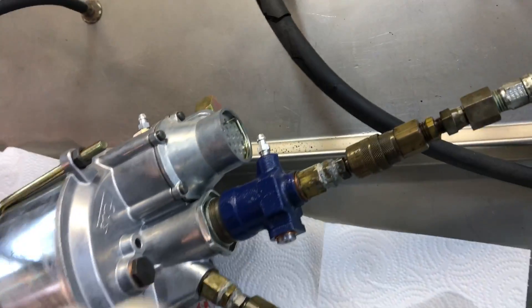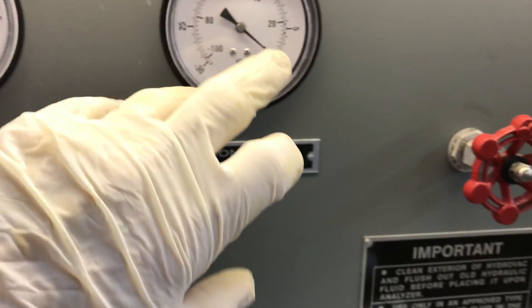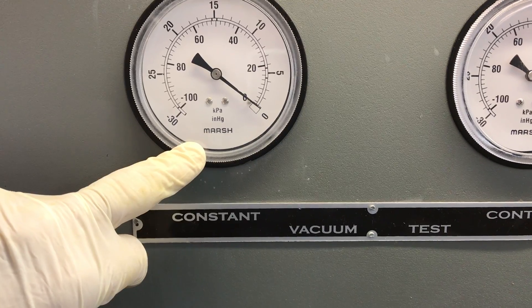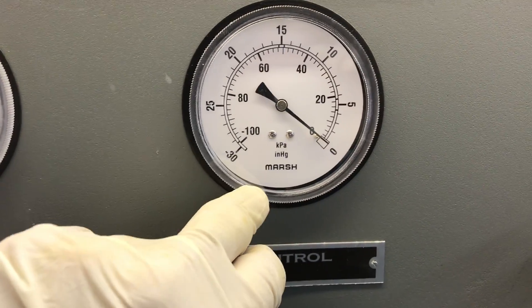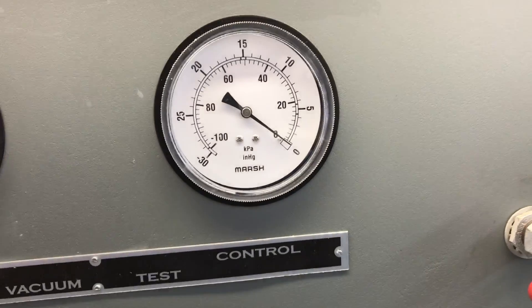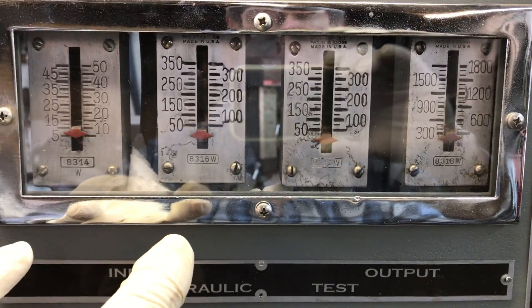What that means is this vacuum hose right here is not going to be used — this vacuum hose goes to this vacuum gauge, so this vacuum gauge isn't going to do us any good. It won't tell us anything. This vacuum gauge is just going to read the vacuum produced by my vacuum pump going into your booster. Ordinarily what would happen is we'd activate the booster and the more it was applied, the closer this gauge would get to zero, but this gauge is not going to move, so we don't worry about it.